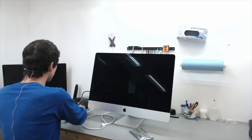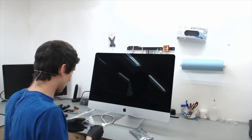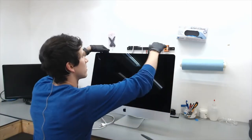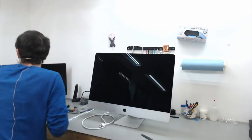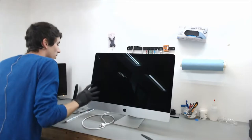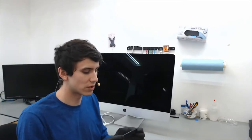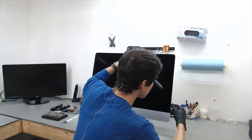We're going to go ahead and dive straight into this repair. For this repair, the screen itself is adhered to the rest of the frame. In the past you would use suction cups and pop it right off. Since the glass and the LCD on this model is bonded, we are going to use this tool — a plastic pizza cutter — which you can get from either Otherworld Computing or iFixit.